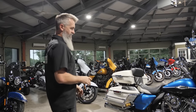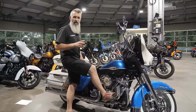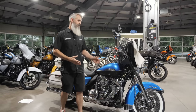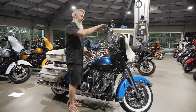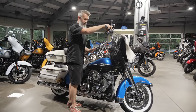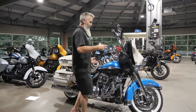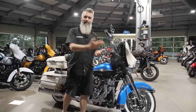It's phenomenal. When you get a Harley and now have that sport bike feel — just a tap for instant braking instead of sponginess — the front's the same way. If you came off a sport bike and went to a Harley, that's one of the things you miss the most. With a brake setup like this you get that feel back on your bagger. You have all the confidence of extra braking, you've increased the braking area, the strength of the calipers — it's a much more positive feel. And once you're braking harder with more brakes on it, that front end is going to dive harder, so opening pandora's box leads to the next thing.